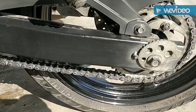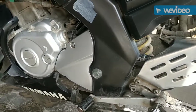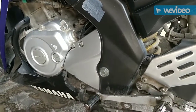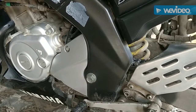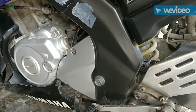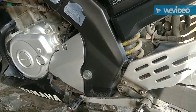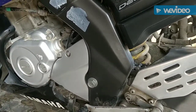The next tip, which should have been in the do's, is do not neglect your front sprocket area, because if you do, after you clean your chain maybe 3-4 times, there would be a lot of residue collected near the front sprocket area, and cleaning it is going to be a huge problem. So make sure that whenever you clean your chain, you take a look at the front sprocket area, degrease it nicely, clean it all up, and you continue with the chain maintenance routine just as usual.